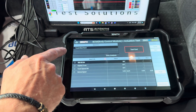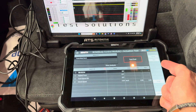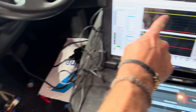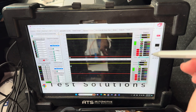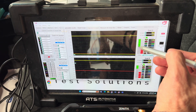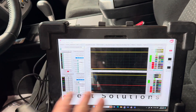We've got the Zenith hooked up in the body control module. We're in the trunk glass hatch. When I hit start, it's going to activate the relay. The relay has power to it. The yellow lead is our power to the relay and the red lead is power out to the latch. I do have the other two leads going to the relay — the control side as well as the load side. I don't really care about the control side; I want to focus on the load side because that's where the problem is.